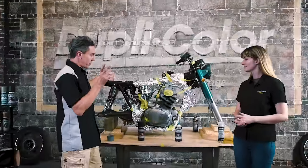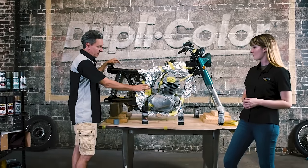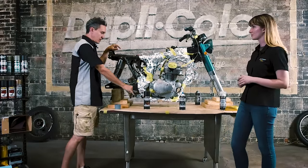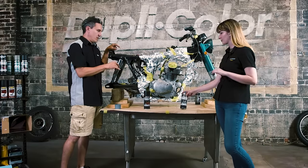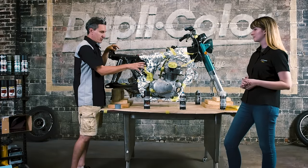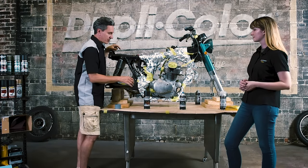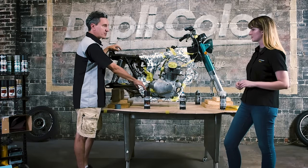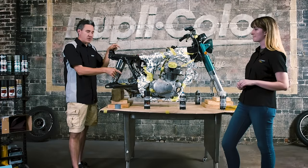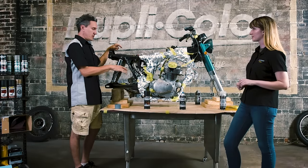We're now starting to lay down paint on the engine. Sophia did great work getting this all prepped — she sanded a lot of the aluminum with emery cloth, which gave us that mechanical adhesion for the primer to adhere to, and then we'll go over the top with the engine paint. Why this specific primer? You definitely need a primer for aluminum — you want it to bite to the surface. We're using the engine primer due to its high-temperature capabilities: it's rated to 500 degrees, matching the engine paint's temperature rating. We're not going to clear coat the engine — just sticking with satin black to match the bike's theme. We'll do two coats of primer, let that dry about 20 minutes between coats, then hit it with black.